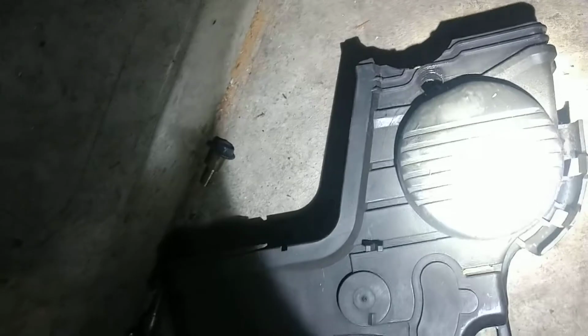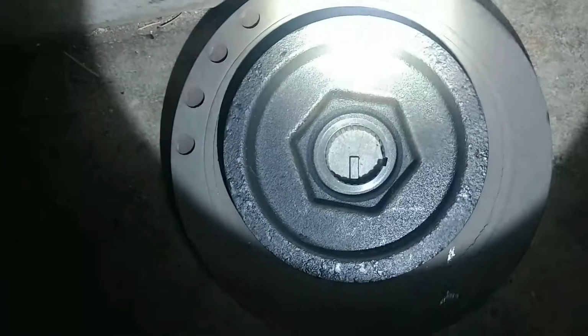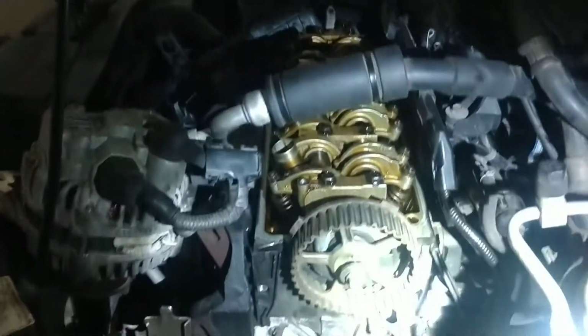And then down below there'll be one to the back side of the crank, one to the front side of the crank, one just above there, and there should be one more, I thought. Oh yeah, there's one right at the connection between the 2 of them. I'm pretty sure that's the overlap one, actually. So you get all those off. Once the crank pulley's off, which takes some wiggling, and there's a shear key down there, and then all that comes apart, and then it comes undone.